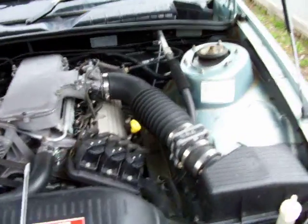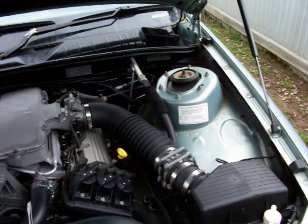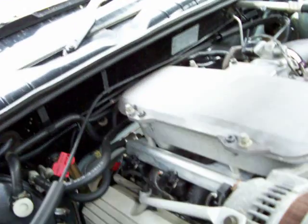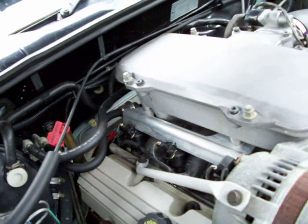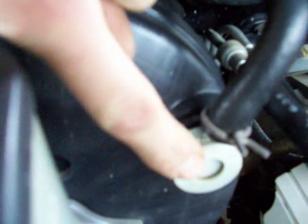You can turbo the Falcon, but I think you're better off measuring it than calculating it with a turbo because it tends to screw with the map sensor - in any case you've got to dyno-tune it if you're turboing it. I've sort of gone off on a tangent. The second idle problem - high idle that's not stable, like a rough idle - is usually a vacuum leak. With the manifold absolute pressure sensor, this thing can tell if there's more air getting into the motor than there should be. A fairly common place for a vacuum leak to occur is between the little seal between the one-way valve and the brake booster.